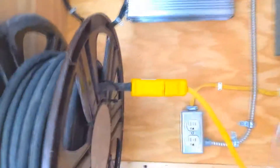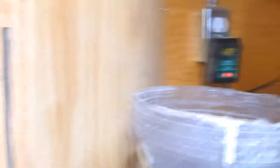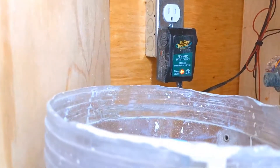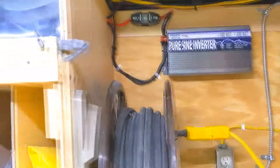When we plug up to shore power, we just come over here — this stuff is really hard to do with one hand, sorry — connect that, and a solid red light means it is charging the battery. If I can keep from punching a hole through my roof and risking a potential leak and save a few bucks, I may not add solar. I'm going to see how long this battery will run without being charged. I'm pretty sure just running these two LED light strips and these chargers, I won't have any problem.